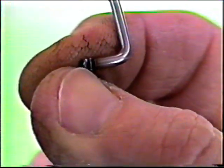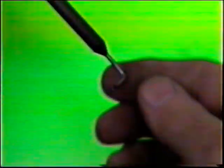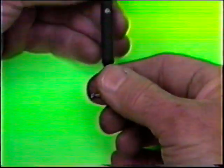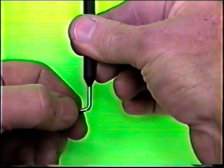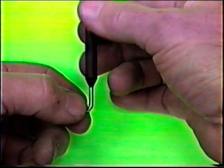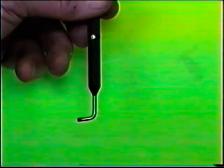And these little tiny grooves, once we get an eyelet on there reversed, these are the safety wire redundancies that we're going to have. And always, these are the things that are, I guess, common sense. They're free, they're common sense. You always want to have the push rod in the system so that centrifugal force is pushing it out. So if in the middle of a flight this washer 10 years from now falls off, centrifugal force would hold that in place until, hopefully, you land, and then it would fall off. It's a free redundancy. You always want to use all the free redundancies to your favor.